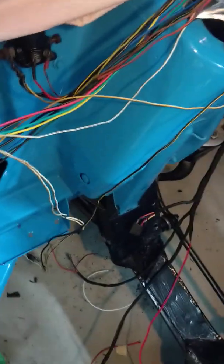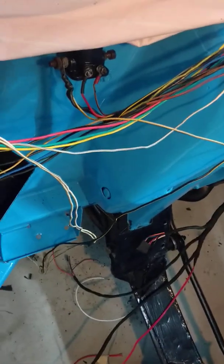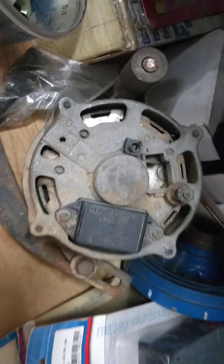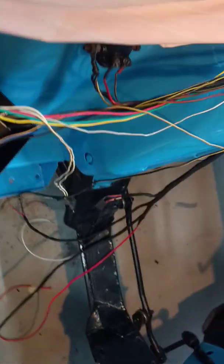It's just going to be two wires to the alternator. The reason I'm making this video is because there's nothing I can find referencing what I think they call 1G Bosch alternators that are internally regulated. Regardless of whether I'm going to use an old one or at some stage upgrade, it'll always be an internally regulated alternator, so there's no point for any of the external regulator wiring. That's how you do it if you want to remove the wiring.